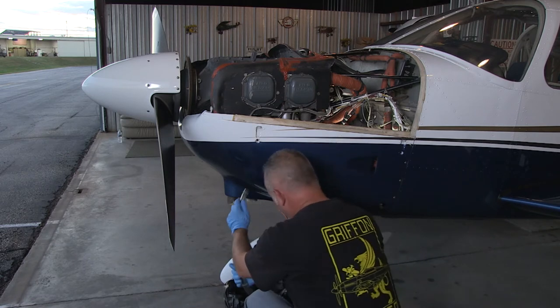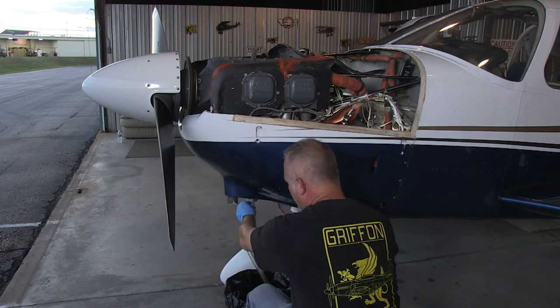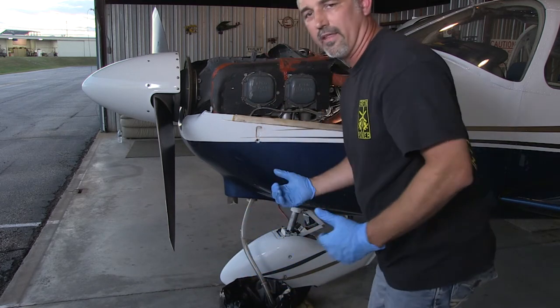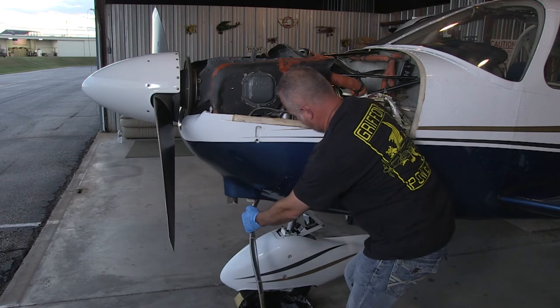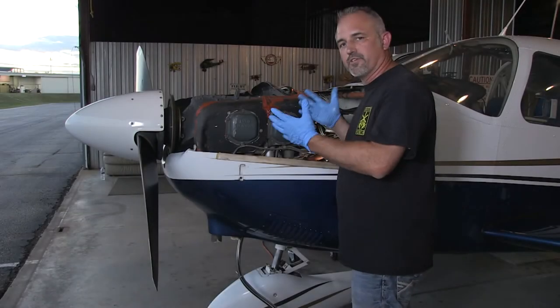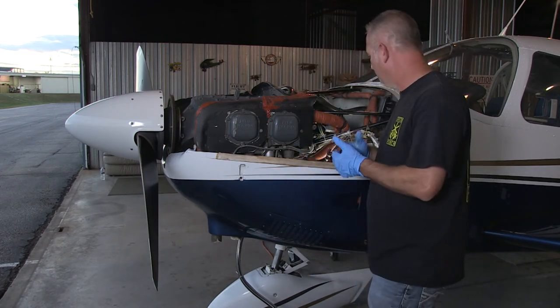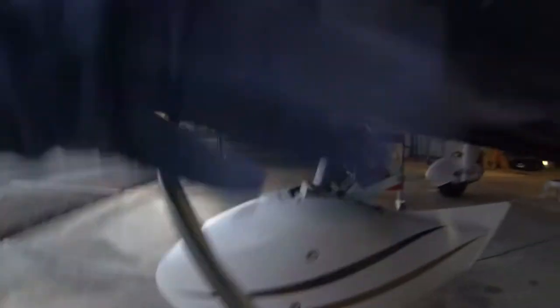I'm going to put the tubing up in the cowling. The exhaust pipes have cooled off enough that they won't melt the tubing. I'll connect the tubing to that little valve, push up on it, and it will start draining out. We're actually draining the oil out from the engine — the engine is warm, the oil is warm — we'll just let that drain out. You can see the oil line connected to the oil pan, and I run the tube out of the bottom of the cowling so I don't have to fully remove it. You can see some nasty oil coming out.